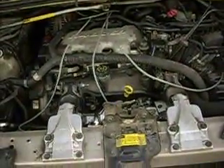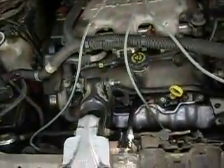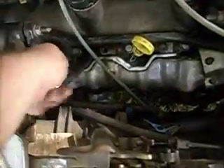I would pull the engine apart and do just this head, but I have no reason to believe the other cylinder head is any better. The only way to really check that is to rotate the engine to access the back cylinders and run my compression test there. In all likelihood this project isn't going to go any further. I think the owner wants a truck, so he's probably going to try to sell this Silhouette for whatever he can get. It's got around 144,000 miles — not super high, but apparently it was never maintained.